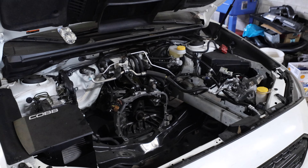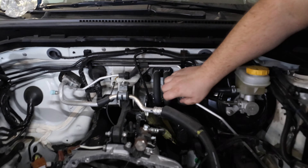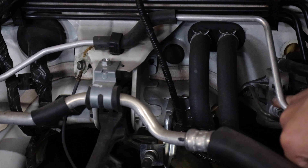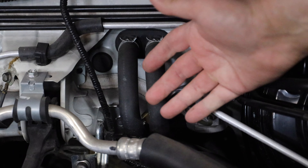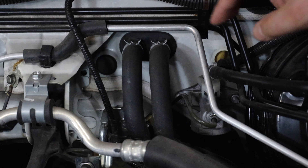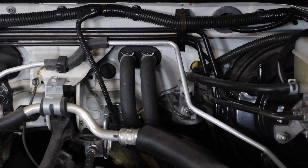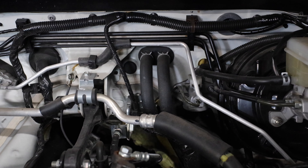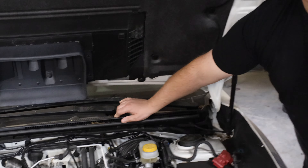We've got no engine. So what ends up happening is the firewall separates and then your slave cylinder doesn't retain the pressure. You'll notice it in your pedals — if you push down the clutch, your pedal assembly will fold in, and that's not good because then it allows your clutch to actually be a little bit further engaged than it should be.